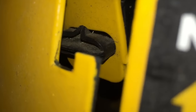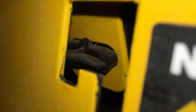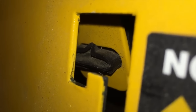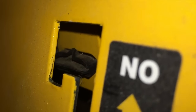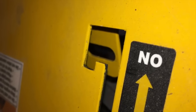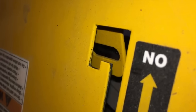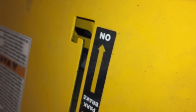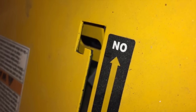When you come to the front of the mower you can see they're just plastic clips holding that safety switch in place. I'll try to take a screwdriver to pinch those clips down. The hole's not big enough to use needle-nose pliers unless you have long-handle or reverse-clamp needle-nose pliers — a standard set won't work because the hole's not big enough. So I'll take my screwdriver and work down the top side first, then get the clips from the bottom side and pop it out. Once it's popped out we can retrieve it from the back side. I ended up using a small flat-head screwdriver, pushed the top clips into the hole first, then lifted up from the bottom while pushing towards the back of the mower and it popped out. I don't think I broke any of the clips, so we should be able to slide the new safety switch back in.